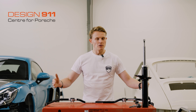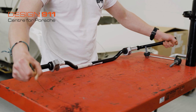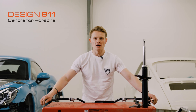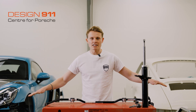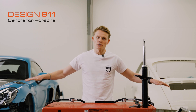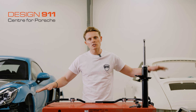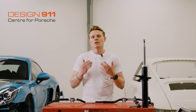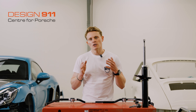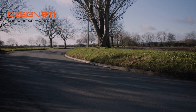If you join the wheels together with an anti-roll bar, as that right-hand wheel lifts up, the left-hand wheel is also lifting up. So instead of your inside wheel lifting freely in a corner, it resists lifting because the other wheel is also trying to lift at the same time. With an anti-roll bar you maintain much better traction with your wheels to the ground, which helps improve handling and drive through corners.